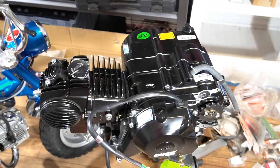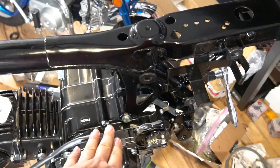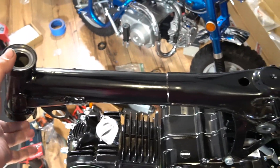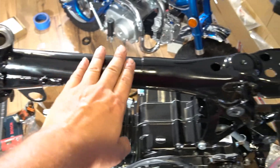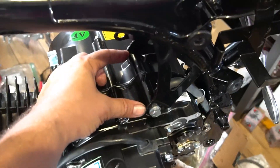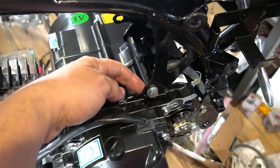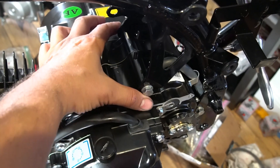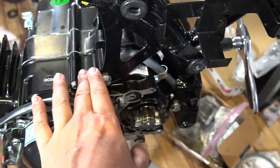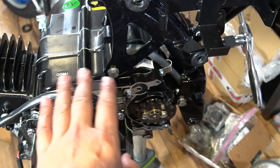I'm going to get the frame set on and then we'll start building around it. I got the frame mounted onto the block. I went ahead and put my inserts in before putting the frame on so I could pound those in without it being on the stand. You might have to finagle a little bit with this mount area here - I just tweaked it outward with a hammer so it will go over, and when you tighten your engine mount bolt it'll pull it back into place. You may need to open that area up a little to fit over these import blocks.